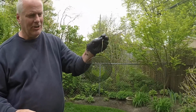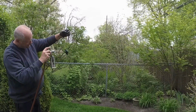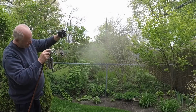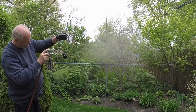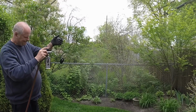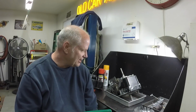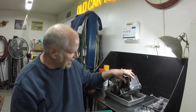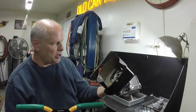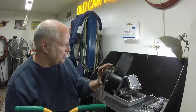That looks pretty darn good. The debris screen, both sides painted. Alright, I'm getting a lot of this done. I gotta get the paint off the black assembly and the blower housing, which I'm going to take apart so I can put a new longer rope in it, and then when I bead blast it, it won't have grit up in the recoil spring.